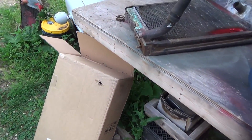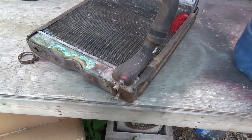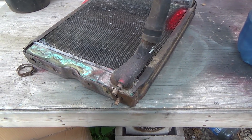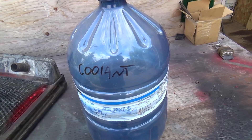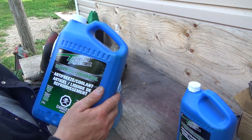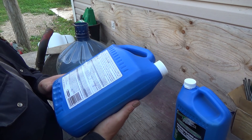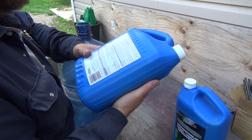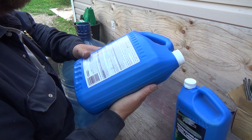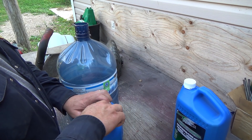And where was the drain on the other one? It was on the bottom of this piece. So that's interesting. Hopefully that's not going to pose a problem. It's on the front of the other one there. Anyways, I got my coolant jug. Coolant — we're going to mix some up and start pouring it to her. So we got some turbo power — the old girl. Low silicate, aluminum compatible, compatible with heavy duty diesel engines. And we're going to mix 50-50 — 50 water, 50 antifreeze. That'll give us minus 37. Could go a little thicker, I guess. I might. We got a measuring dewy here too. We'll see what it's sitting at. We'll get this in here and I'll go get some water.